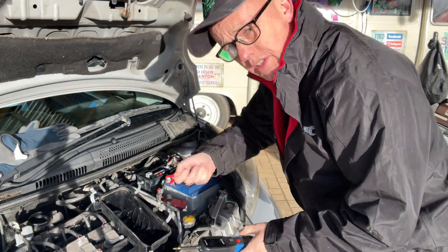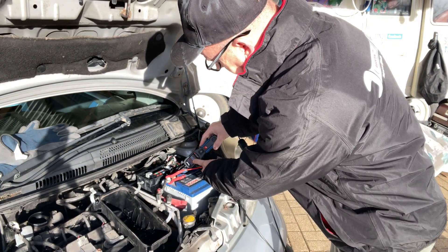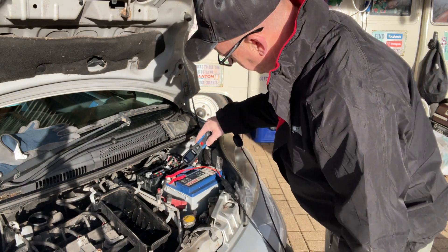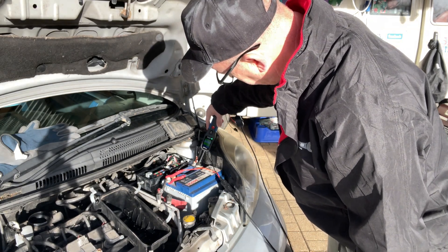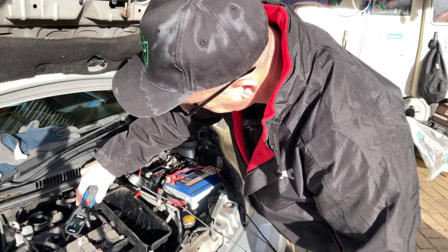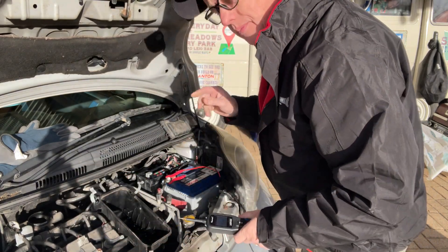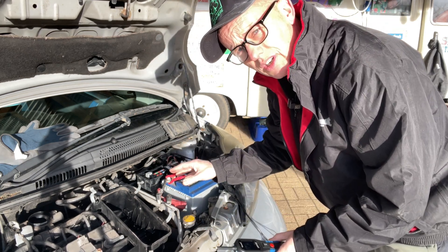If you've got issues with starting - you turn the key and nothing's happening - a really simple test: we just check the battery voltage, 14 volts coming in there. If you've got trouble starting your car, we can do a simple check: battery voltage is good, green earth is good. We can check the engine earth of the car just by touching a piece of metal on the car - straight away, green, zero. We've got decent continuity. We know the earth strap is okay, which then leads us straight to the starter motor to check the feed and switching.